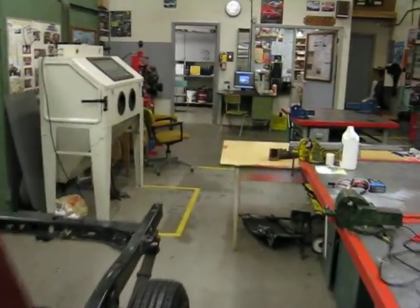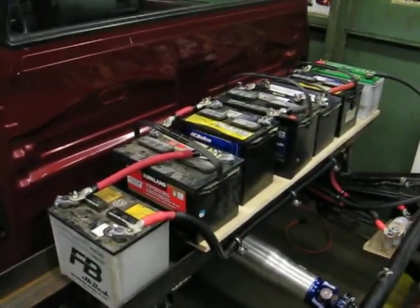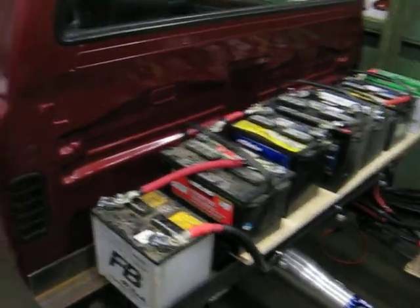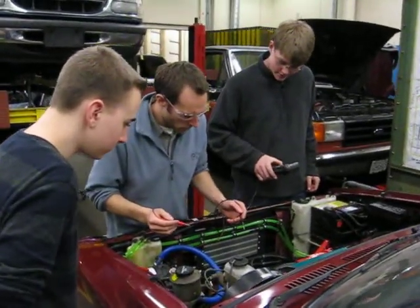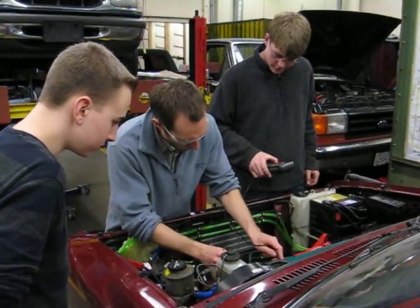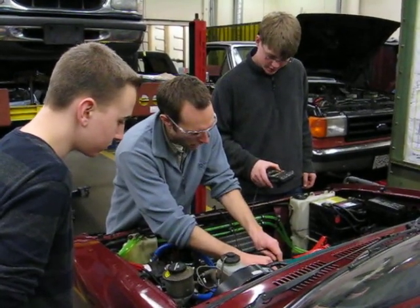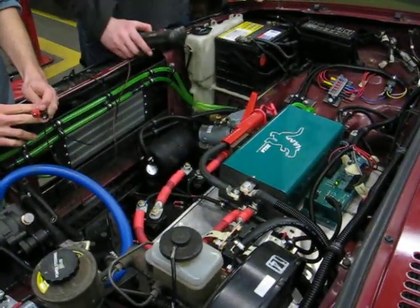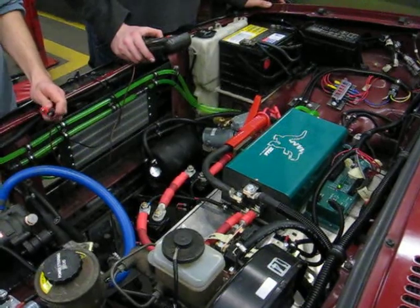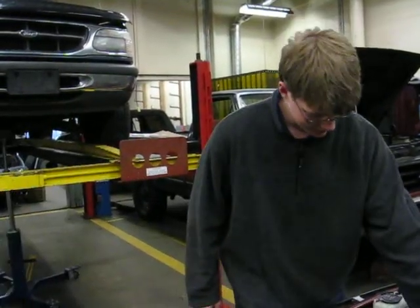Want to see the battery pack — not your eye. Let's grab the multimeter. We're just looking for smoke back here, Mr. Minot. Not even smelling for smoke up here. 92 volts — so we got 92 volts live at the controller. That's great. Coolant pump is running. Let's go check out the shifter and see if that actuates any of our contactors.